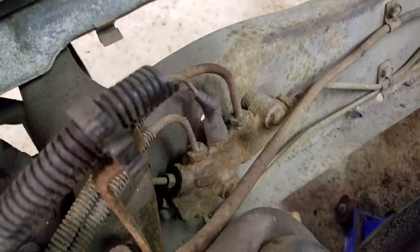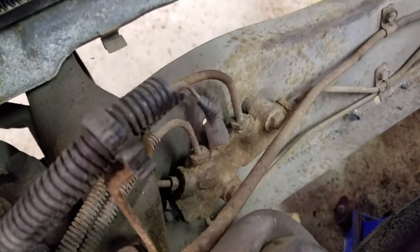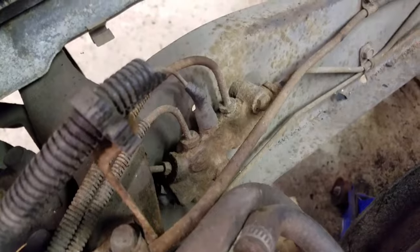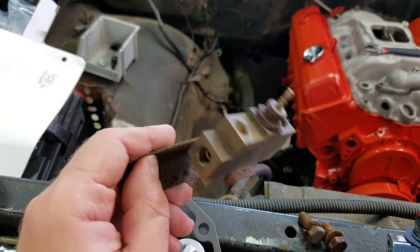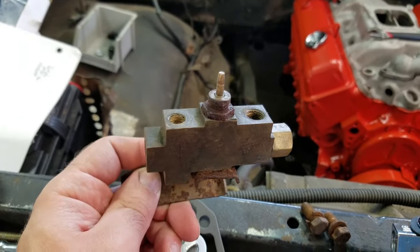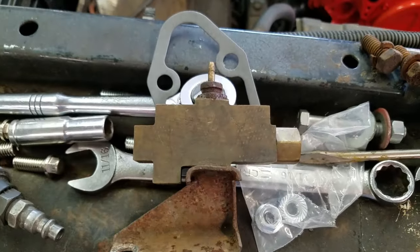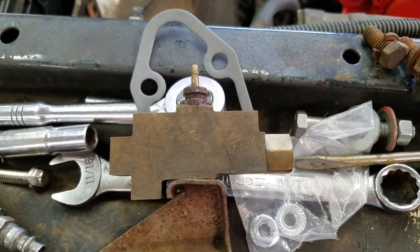This thing in the middle is your brake warning switch — this is what kicks your brake light on the dashboard in case something goes awry in your brake system. From there your brakes go left and right, front to back, to your calipers or wheel cylinders depending on what you have. That's how your brakes work. It is in this proportioning valve — I have one off the vehicle here, this is off a Chevette but all these GM ones are the same principle — where it all goes to hell when you magically cannot bleed the brakes.